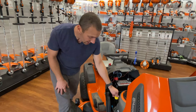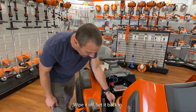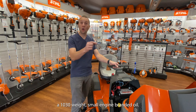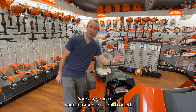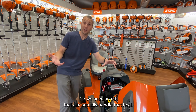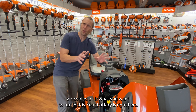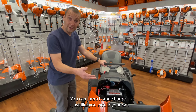The oil check is right here — this little yellow dipstick. Give it a quarter turn, lift out, pull it out, wipe it off, and set it back in. This engine holds right at about two quarts of oil. We always run a 10W30 oil — it seems to be the best for this engine. I'd recommend a 10W30 weight small engine branded oil, not an automotive oil, because your car and truck are liquid cooled and this is air cooled — it runs hotter, so we need an oil that can handle that heat. Look for Briggs and Stratton oil, Kohler oil, Kawasaki oil, or Honda oil — small engine air-cooled oil is what you want to run in this.